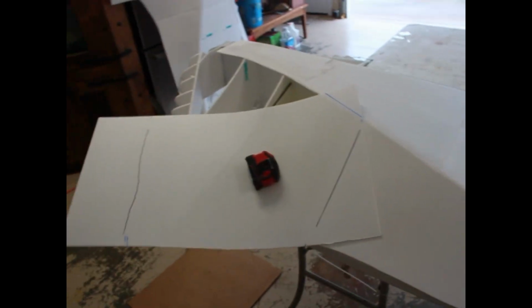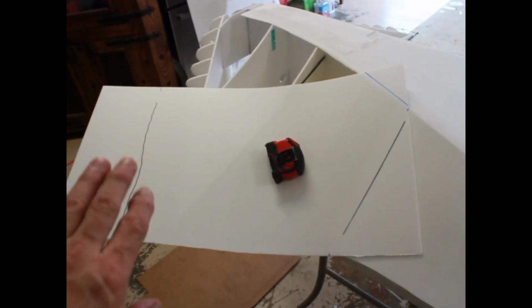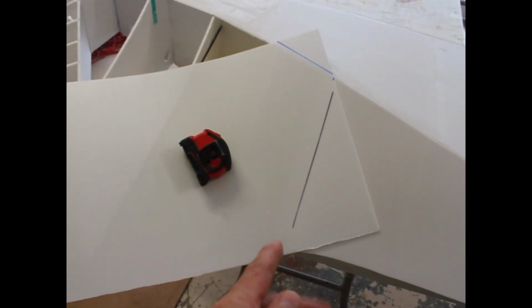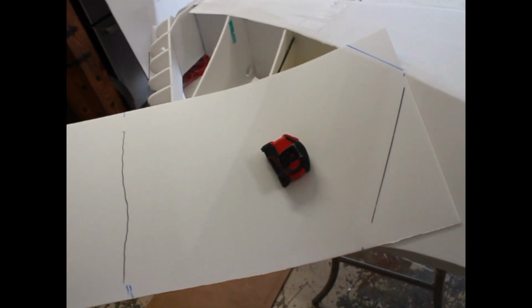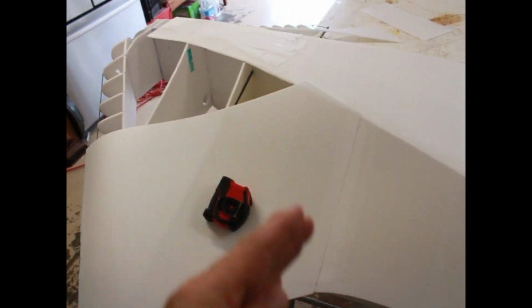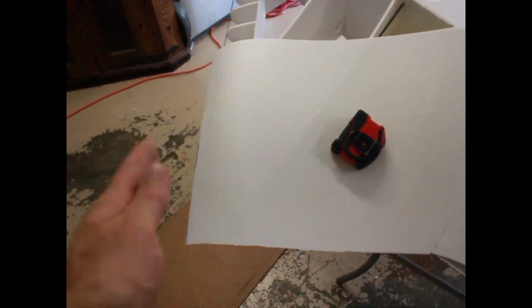All right, so I'm going to put a sheet right in here. I kind of lined out where I'm going to put it on the arm. So I get a little extra there, an inch extra here, but this one I'm going to cut from there to over here where the edge of this is, and I'll match it up, make sure everything still looks good. It always helps if the previous sheet was cut straight, which it wasn't, so I had to go in and trim that straight. Nonetheless, this is the next sheet. It's going to fit in there. I've got a little extra here, a little extra there, but this is flush up against that seam, and this is pre-curved.